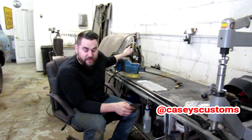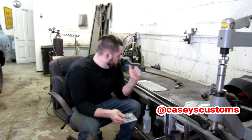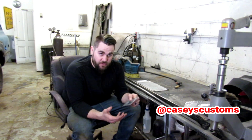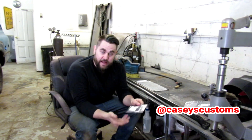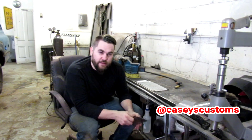I'm also going to do a little TIG welding to see how much better you can control heat with a TIG welder compared to a normal MIG welder. I'm also going to do some grinding and see how much aggressive grinding can move metal, because a lot of people don't realize your grinder can generate almost the same amount of heat as a weld. I've seen guys take all the time in the world welding half panels perfectly, then get in there with a grinder and push real hard — ripping through everything as fast as they can to start bodywork and just wrecking it all. Let's do some tests on these panels.